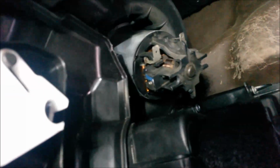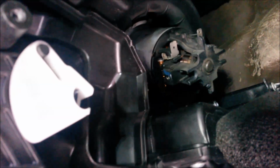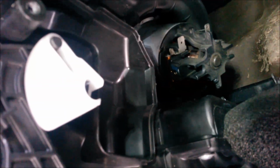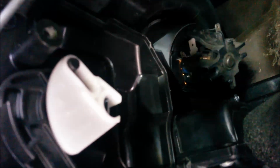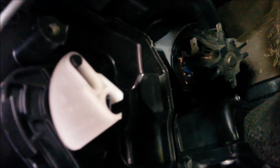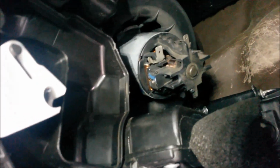And you see the lugs sticking up. That gives you an orientation for the back plate, just when you start sliding it back on, when you move that into position. So I'm just going to do that now. Obviously, you keep that in line with the key on the back plate, and make sure it's true before you press it home, and click the little white plastic clips on the front of the motor. Okay, so I'm just going to manoeuvre that into its position now. There we are. Easy peasy.